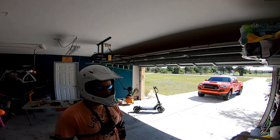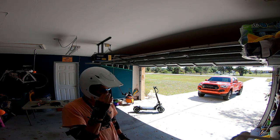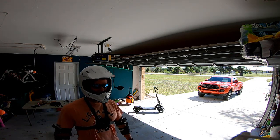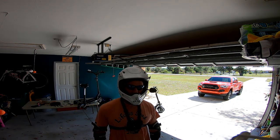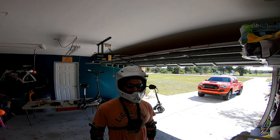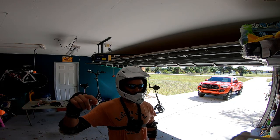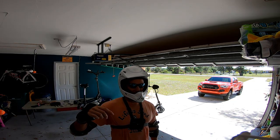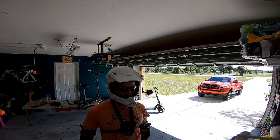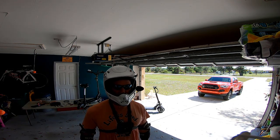As for the Ultra — if you watched the video I posted yesterday, it ended with me pushing the Ultra three quarters of a mile back to the house. The odd thing was I'd been checking the battery indicator the entire ride and it was never going down. It turned out I was messing around with the P settings — configuration settings for the scooter. One of those is the voltage setting: 36 volts, 48 volts, or 60 volts. For some reason it was set to 36 volts, so the battery indicator showed full. Once I switched it to 60 volts it showed correct battery life. It's been on the charger all night, I just took it off — it's green. So now I'm going to get a better sense of the real range on this thing.